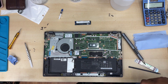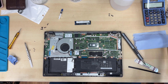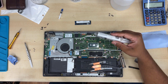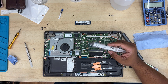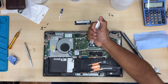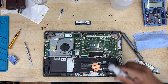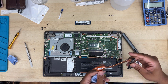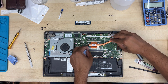When replacing thermal paste, I would suggest getting Arctic 5 — the best quality one. There are a lot of cheap ones on eBay, but those are technically no longer effective after a couple of months. I use this one and the results were brilliant previously. Just apply a little bit, then put back the heat sink. Give the heat sink a clean before you put it back.